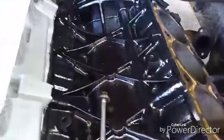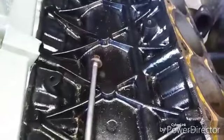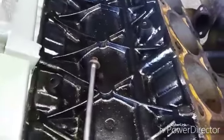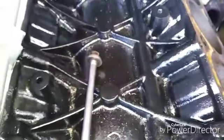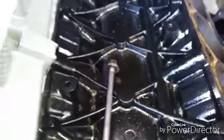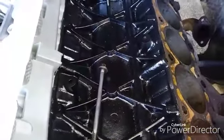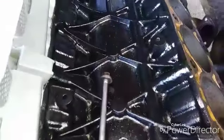When you pull that intake off you're gonna see this looking really nasty - mine was anyway. So that took me a while to get ready. I used a screwdriver brush and then to get all the loose stuff up I sucked it up with the mini vac. Then I used Clean Strip - that stuff's pretty good, it eats up the rest of the rust and primes the metal back to black. That way you know it's ready to be painted. You might want to wipe it down with a wet washcloth to get any residue off.